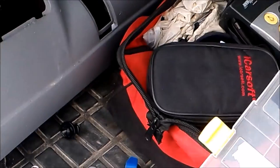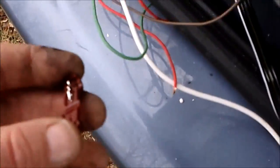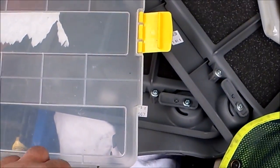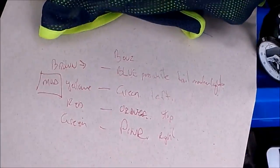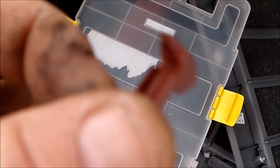Due to the space in there where I can't get both hands and arms in, I'm going to use these splice connectors which basically clamp over a single wire. The one we're going to splice onto — it'll clamp over — and then this side, see that little slot there, the wire that you want to connect to: you take a male connector, crimp that onto the wire you want to connect, and then it plugs into that one.